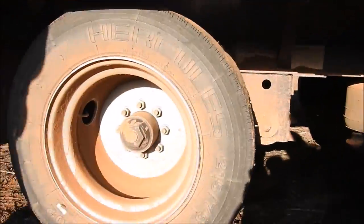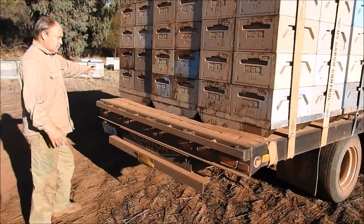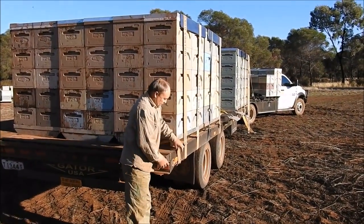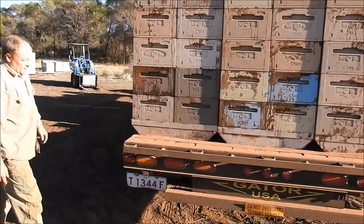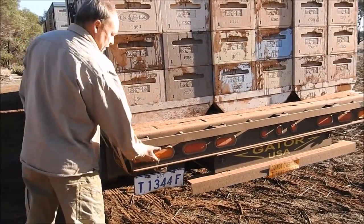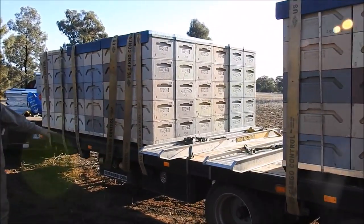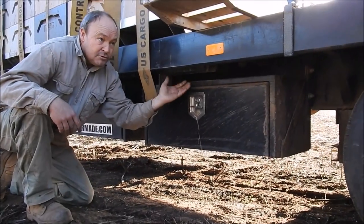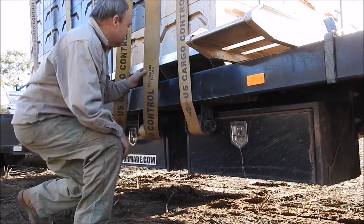As you can see we can fit three pallets wide on the trailer. Now in the US their road widths are different to ours - normally they would have an extra rub rail that goes along each side, but we had to get them to drop that off just to bring it in under the Australian road rules. The guys in the US also changed the indicator lights because in the US some of the colouring is different - they have a red indicator whereas we have amber. On this side we've got two integrated tool boxes and the strapping channel, with winches that just slide in so we can tension up our load nice and secure.